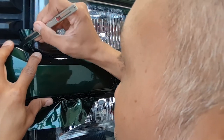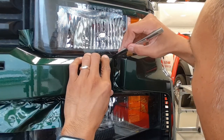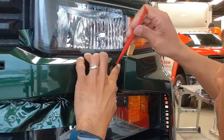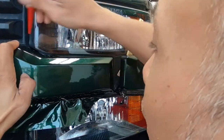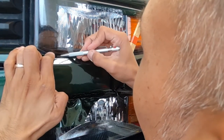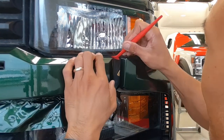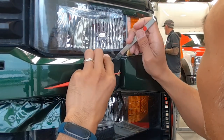I've got the vinyl laid around that corner and I'll do it on the other side. It is a little difficult, especially since the headlight is on there and there's a cheek piece to the right — I have it propped up and open with a plastic stick. If you can remove those parts of the headlight and that plastic cheek piece it will make this job way easier because you can access those corners much better. All I did was trim off the excess using my blade to cut behind the grill, with the side of my blade against the back edge as my cut guideline.